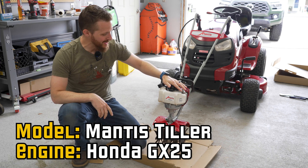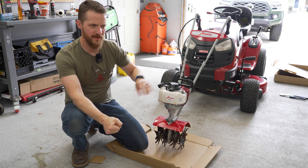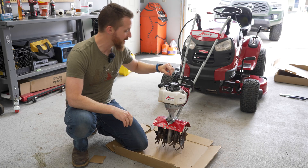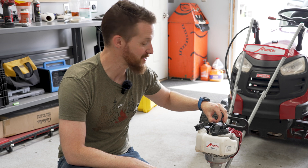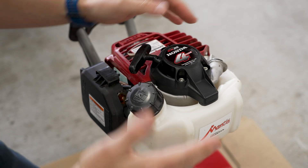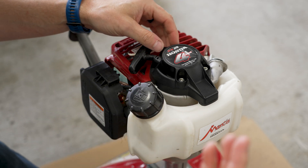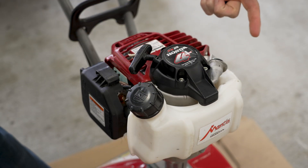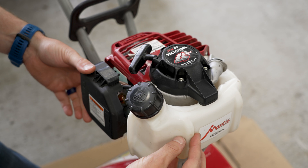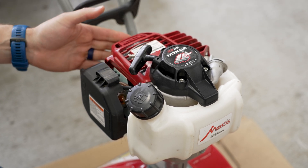Jumping from the big guy back to the little guy. This is a Honda GX25 on this little Mantis tiller. This exact engine is also used on more heavy-duty string trimmers and a bunch of different applications — an awesome little engine. I haven't peeled off the shrink wrap on the logo, so let's do that on camera. I'm going to go over all the same steps on this one as well. This one has a fuel filter but does not have an oil filter — the only one with that is the riding mower. Here's your dipstick and fill plug. Your air filter and carburetor is over here. The fuel filter is actually inside the gas tank and you have to pull it out. The spark plug is in the back of the engine under a plastic cover that we'll have to remove.